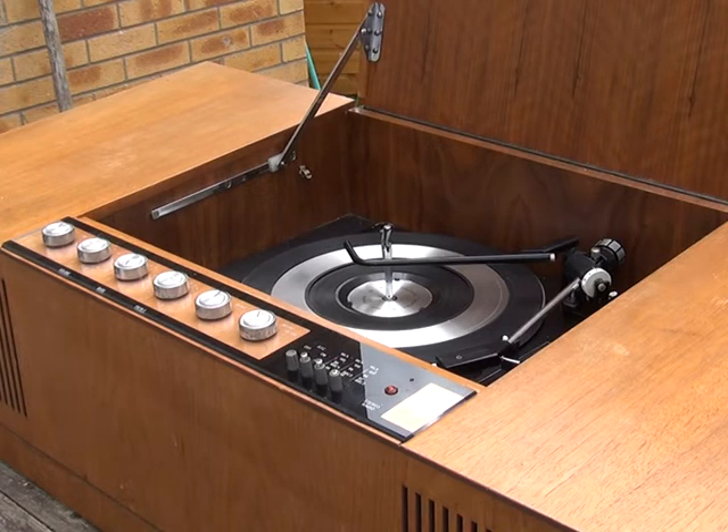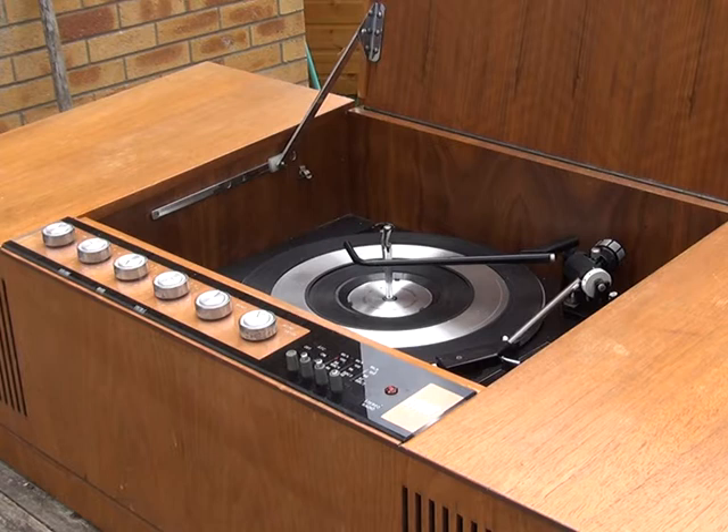Mr Chippy just mentioned it wasn't just the missing speed with the wrong motor — all the speeds were one out. Put it on 33 and it played 45. So that needed addressing, and hence we changed the armature over with the spindle. Hopefully if we switch this on...